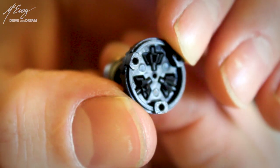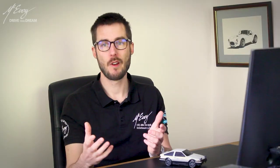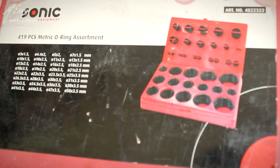How cool is that? If you want to go back, just remove the o-rings, place the spider gears in their location and voila! Fully reversible, lockable differential, virtually for free. All you need are a couple of o-rings. The kit I've shown you here is something I have lying around the workshop. It costs less than a round of beers with the mates and it will probably last a lifetime. I could list and sell these to you, but I would feel like a total rip-off charging anything more than a few cents for a pair of these.